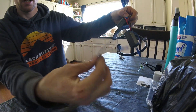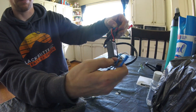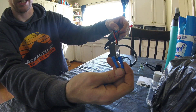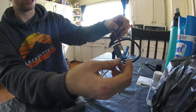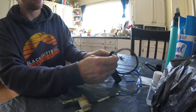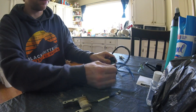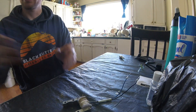This part of course goes to your spark plug wire. We've got wires off the magneto going to the CDI, and these two spare wires coming off here would go to your kill switch. With a standalone CDI and a kill switch, it isn't as bad on your magneto, by the way. Then there's your standalone coil. Let's unhook this and get that out of the way.